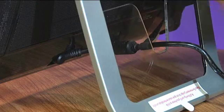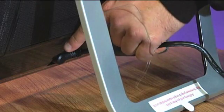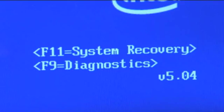If the Power button doesn't work, unplug the computer from the back. Let it sit for a couple of minutes — let it relax, maybe go take a breath outside — then come back, turn it back on, and hopefully that will work. If it doesn't boot up to Windows and you see the HP blue screen with 'F11 System Recovery,' press F11 a couple of times. Watch our video about that — hopefully that will help you follow and solve your problems.